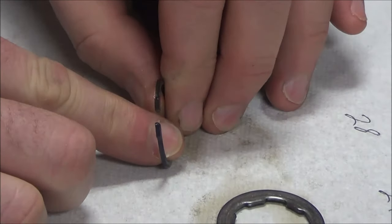We call this the cam stop or the star on shift drums. On your lab sheet there's a place to check the pawl pins — that's where the part of the transmission comes around. When you shift, you go back and forth, and it grabs this and either rotates it one way or pulls it back. Grab your shift pawl — the hook, if you will — and inspect it. If you have wear on this pin, you have wear on the pawl. Every part of this transmission has a mating part, so you've got to really build that relationship step by step. Every single little piece of this needs inspection.